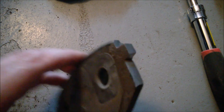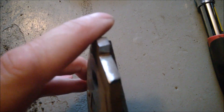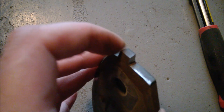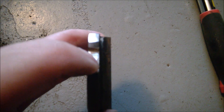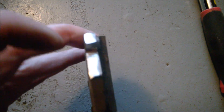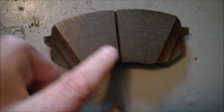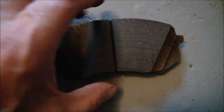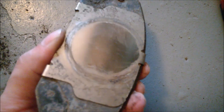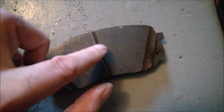So what I did: I got my grinder with a surfacing disc — not a cutting disc — and I just removed a little bit of material, especially on these sides — the tiny legs — and also on this surface right here. I'm going to put just a little bit of silicone grease over there. I also noticed that normally this groove just gets filled by dust material, but on the piston side the dust was very hard, really cooked in there, really hard to remove.